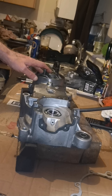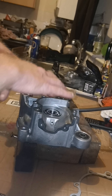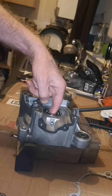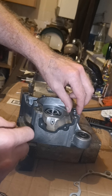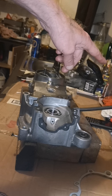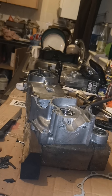Now that I've got that bearing in the back, I'm going to put the front end on of the engine, this side casing, and the chain. But before I put the seals in, I'm going to scrape this old gasket off here, just in case I need a little bit dropped down into the seals. Then once the black's off we'll put the crank seals into this case and the other cases up there. So we'll scrape this black gasket off now, and that's all the black gasket off.